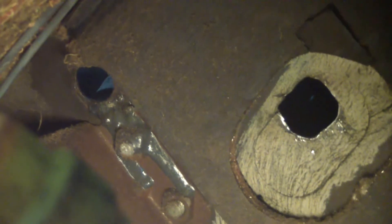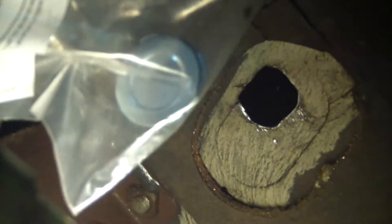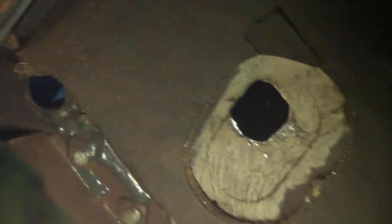Here's the weatherstripping I installed in the dash. Tough to see, but I'm pointing at it with a screwdriver — just installed a couple rubber grommets. These cables are sitting on sheet metal, and once I get the dash in place I'll probably silicone those up. This whole cabin was getting filled with smoke from the blow-by from the engine. Got a couple other holes on the other side of the column and I'm going to use conduit plugs to try to seal them up. Not the prettiest thing but it'll keep the carbon monoxide out.